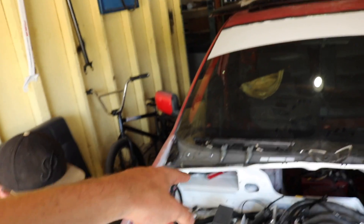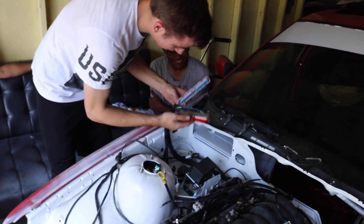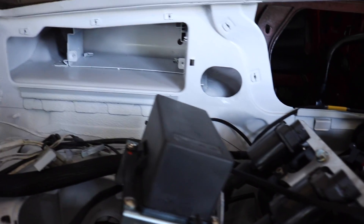We're going to put oil in it, we're going to hook up the ECU, and we're going to cut that out. So we have to cut out a thing for the ECU, and right here is the check engine light and the OBD2. Back in where the ECU goes, there's a hole, and we're just going to cut it a little bit bigger to where we can get this plug through there.